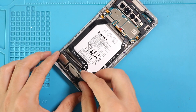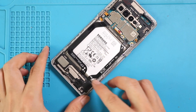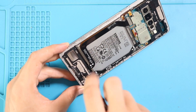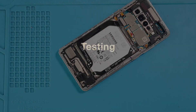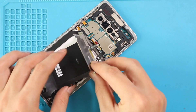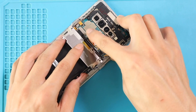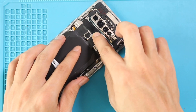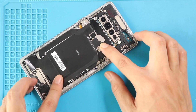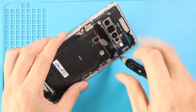Next, place the secondary board cover by adding four screws. Next, before placing the wireless pad, it is good to connect the battery plug and test the screen functionality by powering up the device. Once the testing has passed, place the wireless pad by securing five screws and the connector.